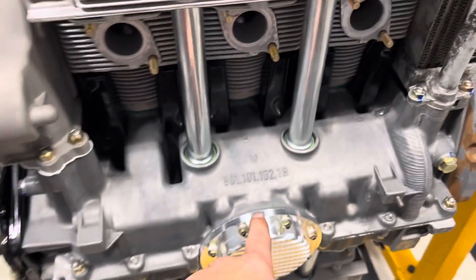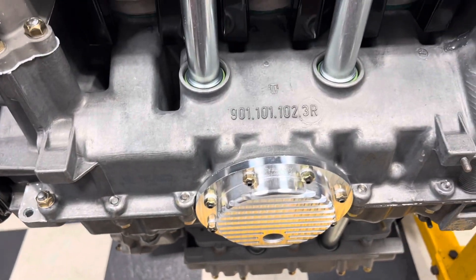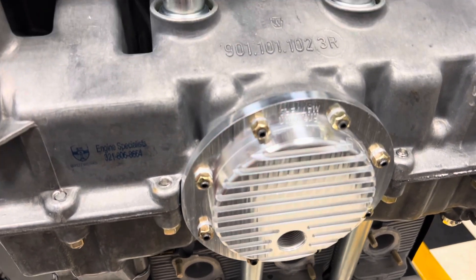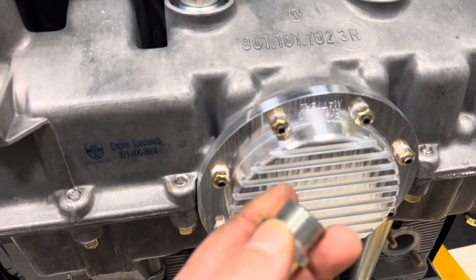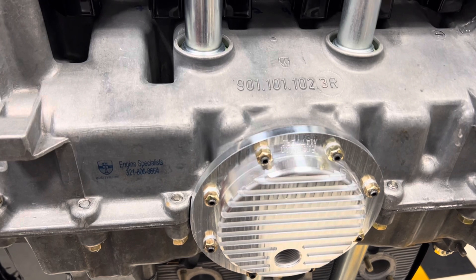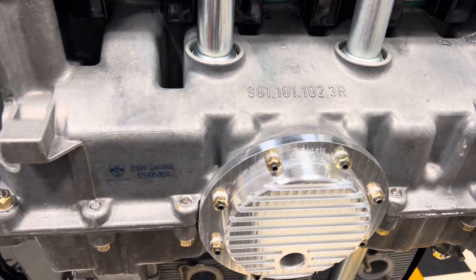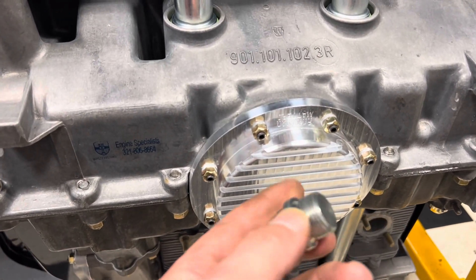That's a wrap, folks. Let this guy dry overnight. Ironically — and you guys who watch my channel know I love pointing out irony — I ordered this from LN Engineering. LN has convinced everybody on the planet they need to use a magnetic drain plug, and it ships with a drain plug that is not magnetic. So we're going to put a magnetic drain plug in there. Especially during engine break-in, you've got to get all that stuff out of there. You've got the magnet here, a magnet in the sump, and then you also have your oil filter. I can't believe there was no magnetic plug.